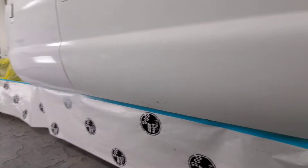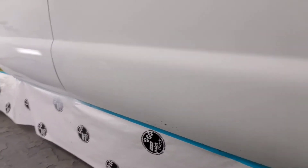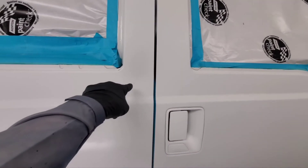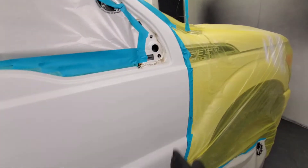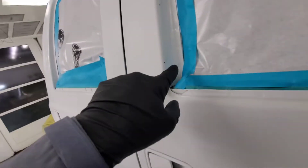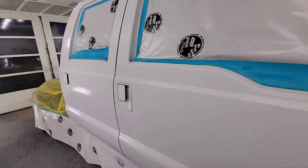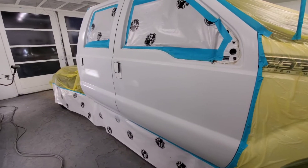So this is a work truck — it's got some gravel rash on the bottom of the door. My next coat I'm going to put some white on that. Because I had a spot up there I'm going to blend up. I'll put some color on that and probably blend it all the way up here, and blend it underneath that mirror. I even see there's a little mark there — I might just blow some paint on it because you won't even notice. But it's the little things, the little details of touching things up. The inside here where rocks have hit — put a little bit of color. The customer might not even notice it's been touched up, but it's always about the little things to really make people happy.